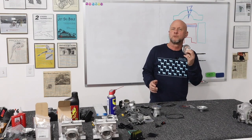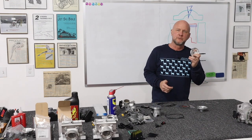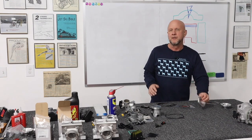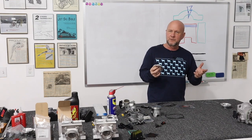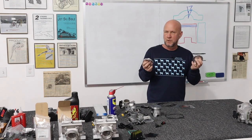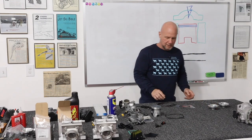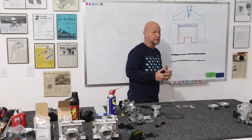The lower compression insert works great. You're shooting for the range of 180 to 190 psi. This works great from 0 to 4,000 feet. From 5 to 7,000 feet I would just use the stock insert — you can check your compression and see where it's at, and I think you'll find it falls in the right range when your base gasket stack is correct. After 7,000 feet, I did make a slightly higher compression insert. The things are only $79.95 — you don't need to spend a bunch of money. You can buy two inserts for the cost of what other people charge for one, and between your stock insert and these you're covered between sea level and 11,000 feet. After 7,000 feet I would put the slightly higher one in, and at that point you could also take one base gasket out to lower port timing if you're looking for more bottom end.